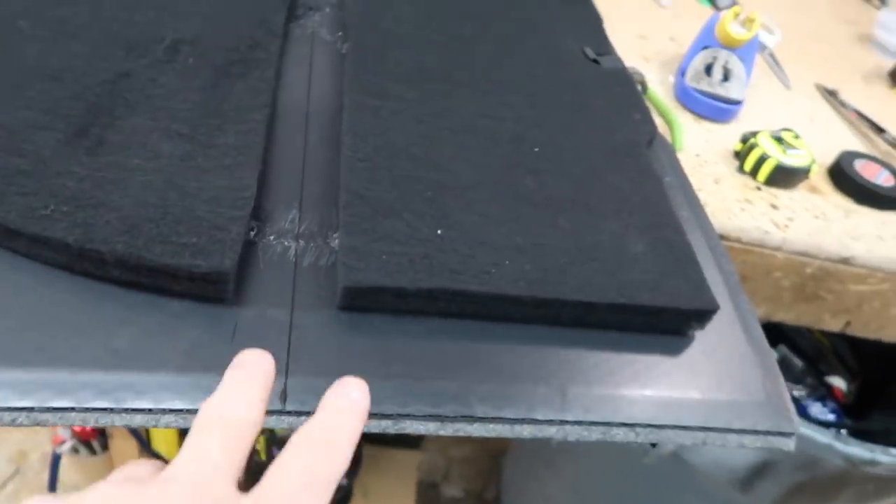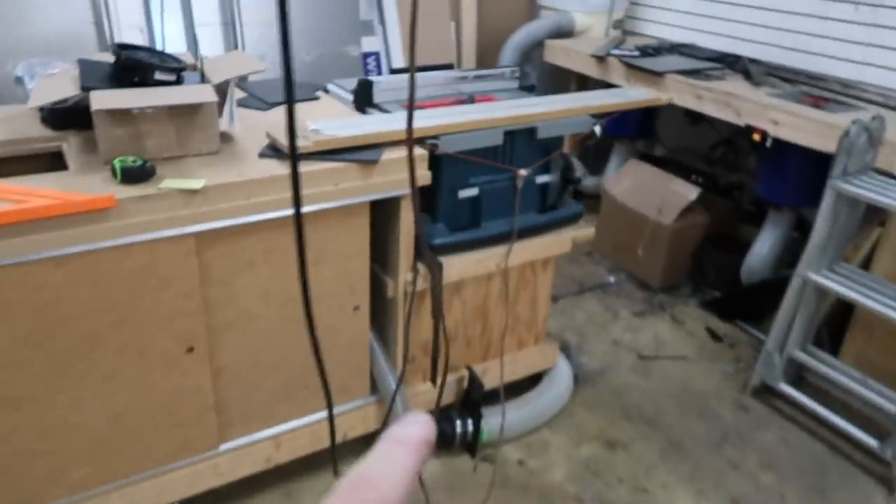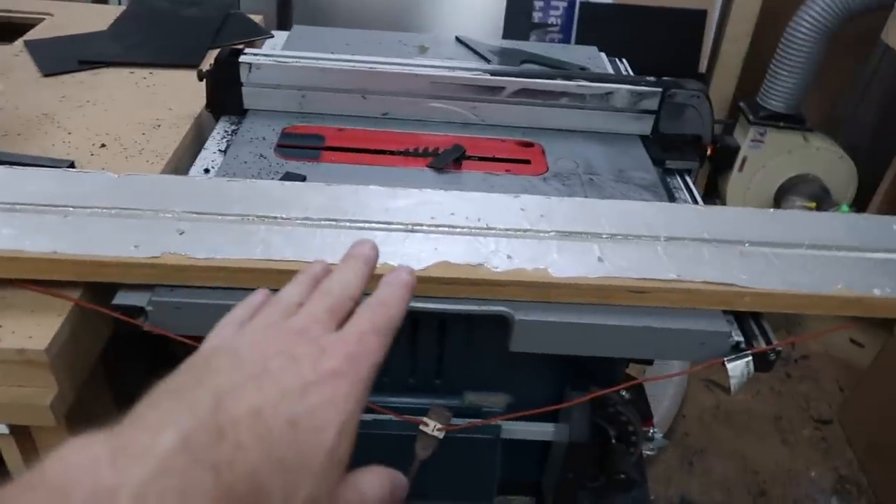One of the things we want to do is make it so he can lift it up and get to the tire pressure thing. We have the back cover here — it's made out of plastic. That's why we put that brace in there. Fernando's come up with a plan that he thinks might work. What we've done is we've put a groove down the center here, and we want to try to bend it at this line. Over here we have a plastic heat strip — I've had this guy for about 20 years now. We're going to set it on top of there and hopefully get the plastic just hot enough to bend it and tighten that area up, making it like a hinge like they do in a lot of cars where you have dual plastic with carpet over the top — a factory hinge. That's the plan; got my fingers crossed.